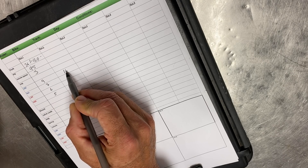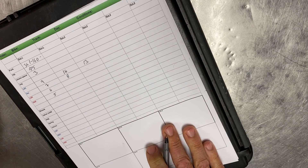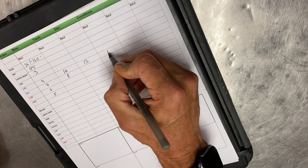If I'm at 16 low-speed compression, I'd do a run and make a note — say it felt really soft, dove a lot. Then my next run could be 13 on low-speed compression, changing only that one thing. Going from 16 to 13 is a significant change and you should feel something. Say at 13 the fork dove a lot less but was still pretty soft, and at 11 it felt skippy — didn't track the ground, vibration through the hands. So 11 was worse than 13.